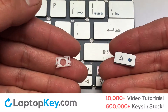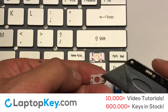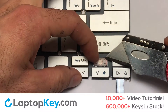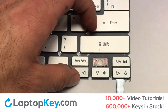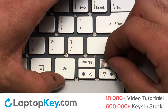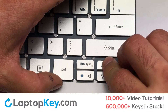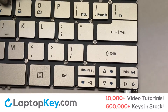We're now going to install the small key. Gently align the retainer clips so that they catch the metal hooks on the keyboard. Apply pressure to the lower tabs so that the key retainer catches onto the metal hooks. Place the rubber cup in the center. Place your keyboard key on top of the retainer clips. Press down to attach the key. That's all — you have now installed your laptop keyboard key.